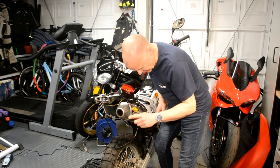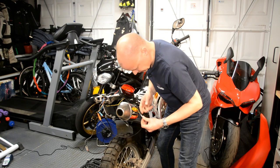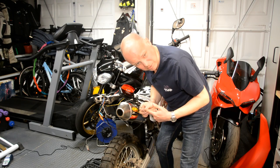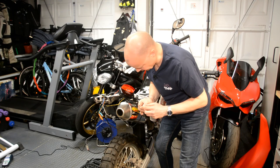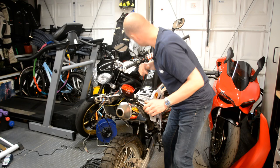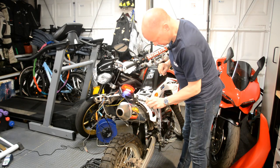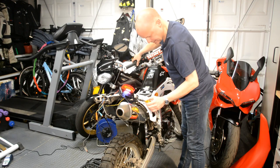Okay, so a bit of head scratching, and having traced the wires back, the connections all look good. The only thing that can be wrong is that these are the wrong way round, because I made a guess on which way round they go. So I've swapped those round on each indicator. So let's see now if that works. Right, power. Got the rear light. There's one, let's go for the right indicator.